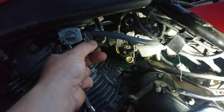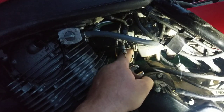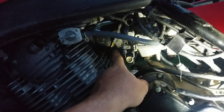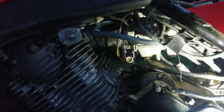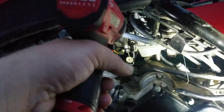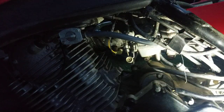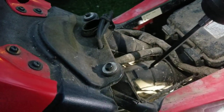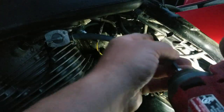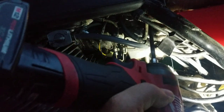Get that right out of the way, probably under the petcock. Now let's get right to this clamp — looks like it might be an allen head. Yeah, all right, so we got an allen head clamp there and the throttle on the other side. That's held on with a three millimeter allen head bolt — well, clamp. And then there's another clamp right here for the front bellow. This pipe right here is what we're taking off next, and the clamp for that is up underneath.